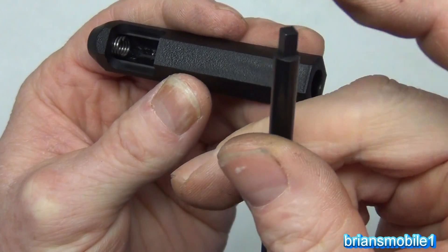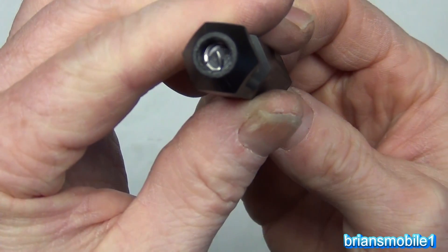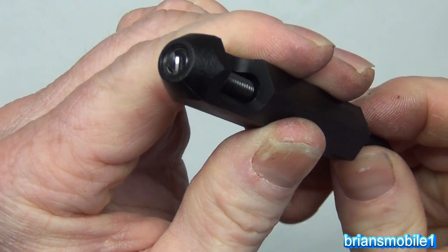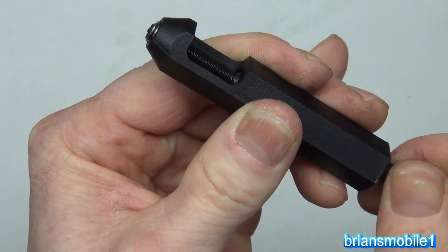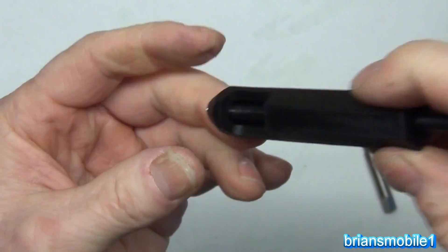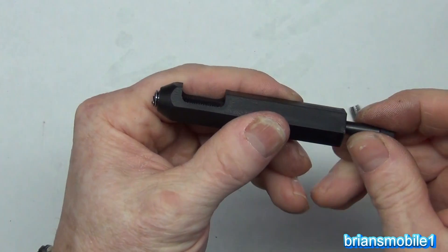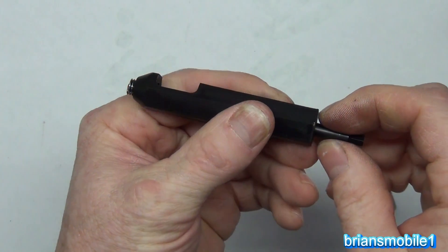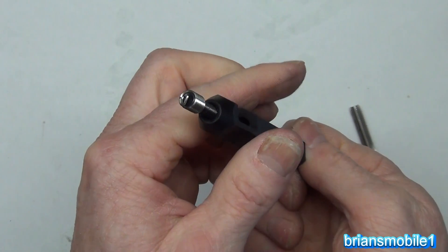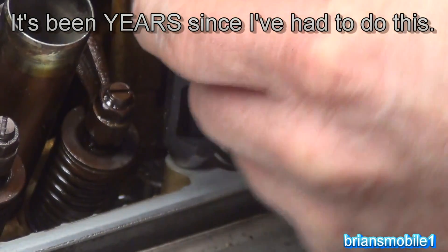Now this is steel, so you can turn this with the tool pretty well. The thread's inside the helicoil, and what you'll find is it'll bottom out. So you just screw it down through. Now I can do this with my fingers because I chased the threads on this. If you rely on it the way that it is, you hear it squeak — it's tight. So you want to have two threads hanging out like that. Then you hold the whole thing by the tool and just start it like a bolt — two threads into the thing. Once you're two threads in, go a little bit with this. Make sure you're nice and snug, nice and level, and then just run it all the way down the hole and snap off the end. Or if it bottoms out, that's fine too. Start it in there and then continue.